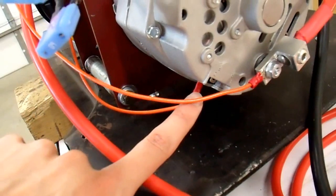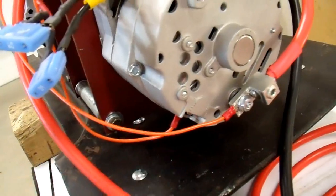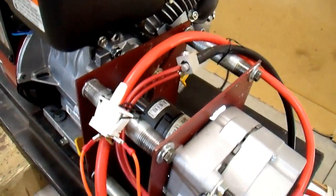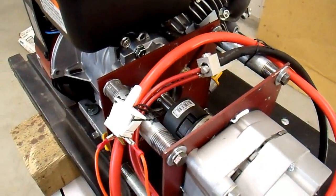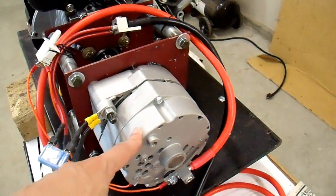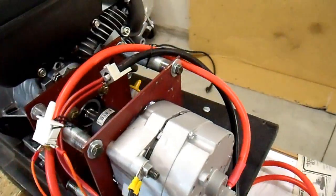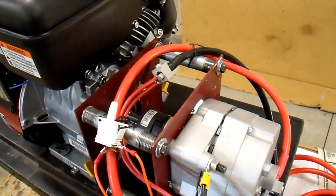The number 2 terminal has to be connected to some sort of electrical source in order to power the field. So I have that connected up to a momentary switch, and I can just push this to turn on the alternator. Basically I start the engine — it won't be generating — then I push the switch and it will be generating. As long as the engine remains on, it will grab its field power from the output of the alternator. As soon as the engine shuts off or runs out of fuel, the field will shut down, as long as this is a momentary switch. That's why I chose momentary instead of a toggle switch.